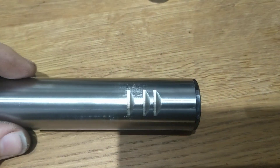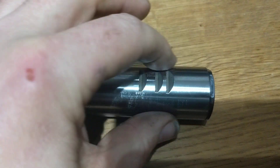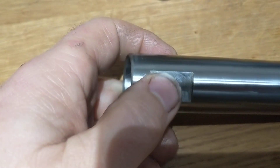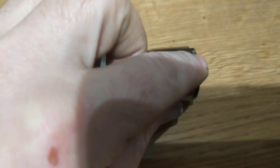So what you do is heat this end — it's best if you can to rotate this while you heat it, just at this end. Then using something to grip it, you can use an adjustable spanner on one of the flats on this end and then another adjustable at the other end. You then wind the plug out.